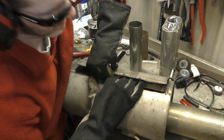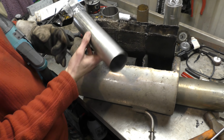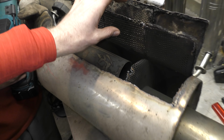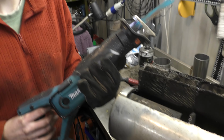What's the plan here? Cut off this much pipe, about that, and then try and sleeve one of them in between the two. Might have to chop that as well. Zigzag style, couple of welds, biff, baff, baff. Doesn't need to be airtight. We just want most of the air to not circulate the box. We want it out the outlet pipe in there, with all directness.